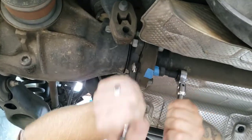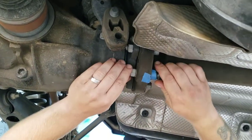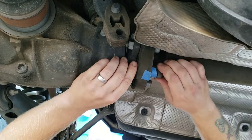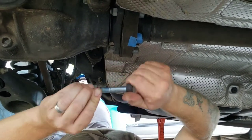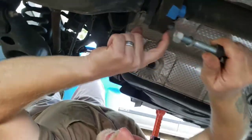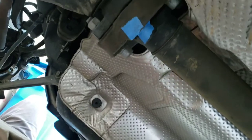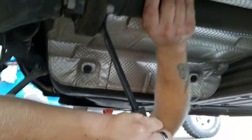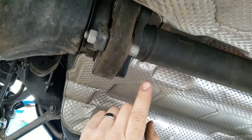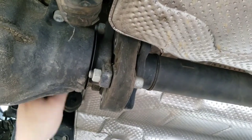Now that the exhaust is out of the way, I used a little bit of tape to mark up the alignment so we go back in the same spot when we put it back together. We'll have AJ put it in neutral, flip the driveline around 180 degrees, and get that last bolt. One thing I noticed is that the lock washers are on the rubber — they all go this direction, and the lock washers stay on the rubber. Just something to note.